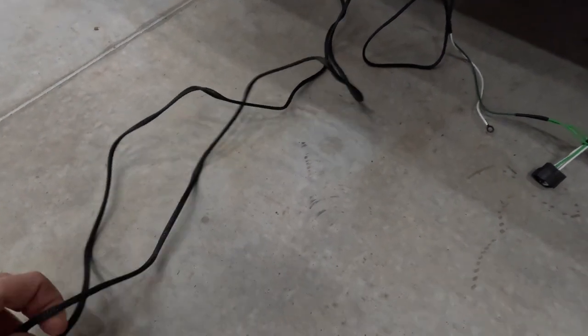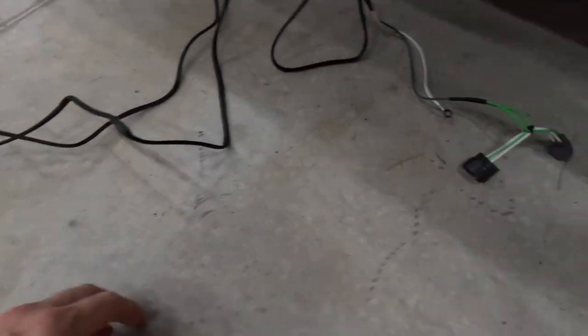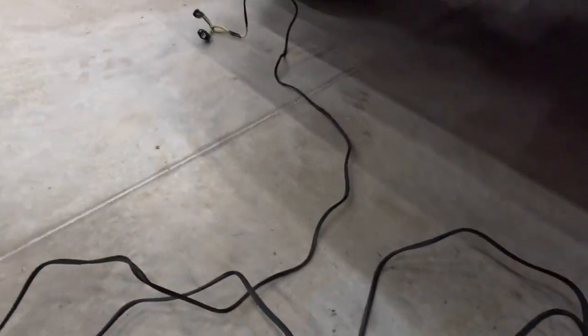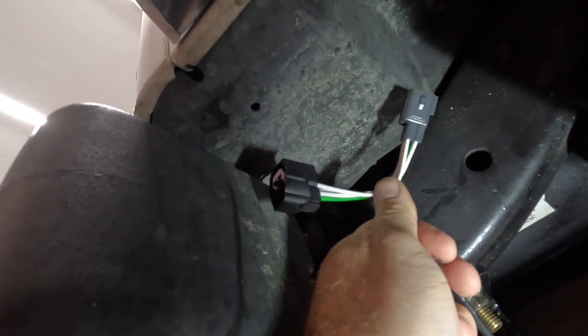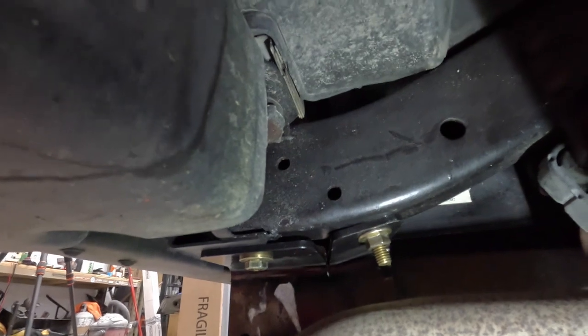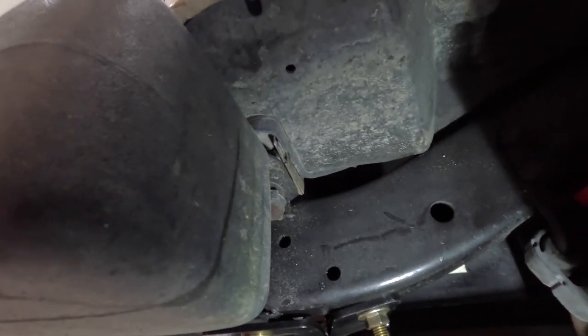So on to the wiring. This is what the harness looks like once you get it unbundled. You've got two groups of wires coming off your four-pin. The one with the green wires goes over to the passenger side, the one with the yellow wires goes over to the driver's side. You've got to loosen up your splash guard — it looks like it's just one push pin and then we should be able to swing it out and stick our hands up inside there to get at the plugs. We'll fish these wires up there — one plug goes into the connector, the other plug goes back out to the light, route them down to the hitch.